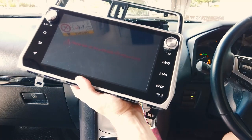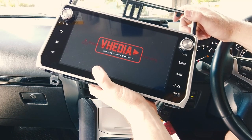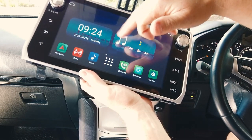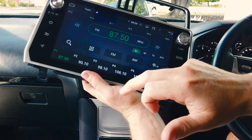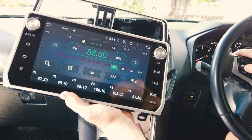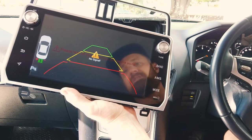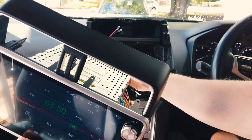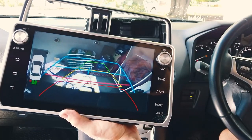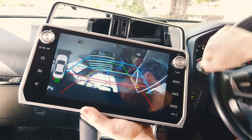Push it in correctly, then plug in the main 20-pin plug. Turn the car on to ACC and make sure the head unit powers up. You only see the startup screen the first time it powers on — after that it quick boots in about four seconds. We're getting information from the car — it tells us both doors are open. Do a scan of the radio, get sound coming through, and steering wheel controls are working. Put the car into reverse and confirm the reverse camera comes up with parking sensors displaying. Moving the steering wheel shows the tracking is working.